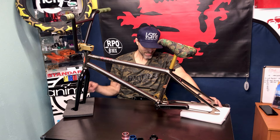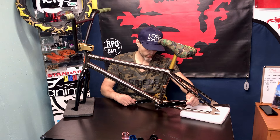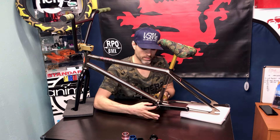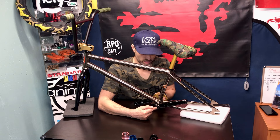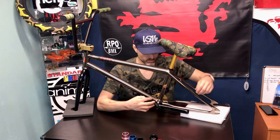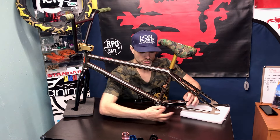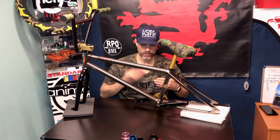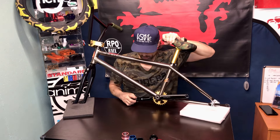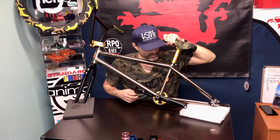The frame material is Sanko Japanese chromoly — not made in Taiwan. It comes from Japan, then goes to East Sussex, England, then ships to my distributor in California, and from there makes its way to me. Mickey Fleck is usually over in Barcelona. The United Supreme V3 cranks use a 22mm bottom bracket with a thick volcano bolt and volcano washer inside. These cranks looked so good going on — beautiful gloss black with 'united.' in lowercase outlined letters etched in black.